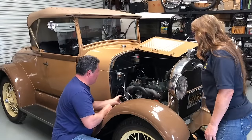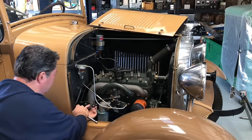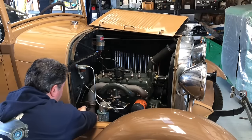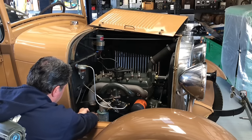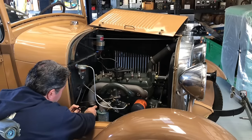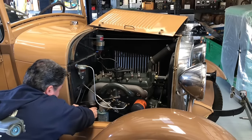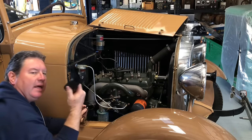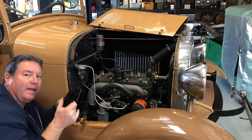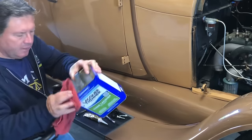All hooked up — should be ready to go. Brody has a slightly unusual aftermarket clamp with no nuts behind it, just bolts, so it shouldn't be too hard. Let's get the clamp off. This has one of those inserts and the little ring thing in it. Some people say throw that insert in there and that'll prevent exhaust leaks — well, here's an insert in Brody's exhaust, and Brody clearly had an exhaust leak, so that clearly does not work. That's why you need an exhaust system with the proper flange. I'm going to get this muffler ready to put on.